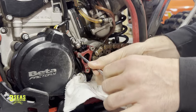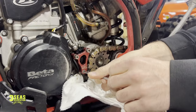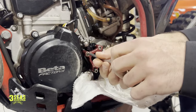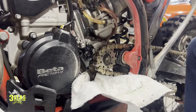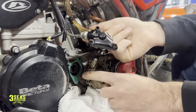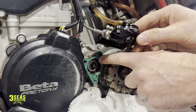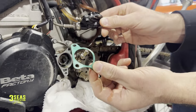If you're doing a slave cylinder, I would recommend — if we're selling you this — I would probably sell you this billet guard. We've had really good luck with these guards; we've been running them for about 10 years on the Betas and they work really good. So you don't really have to worry about anything on the back side coming out. I'm going to slide this out — this goes straight into your clutch side. I'm going to pull the old gasket off. Old gasket's off.